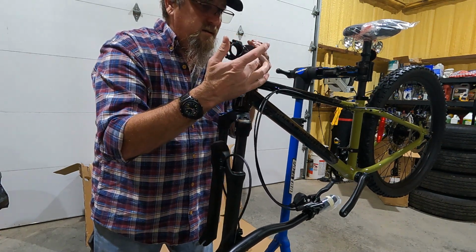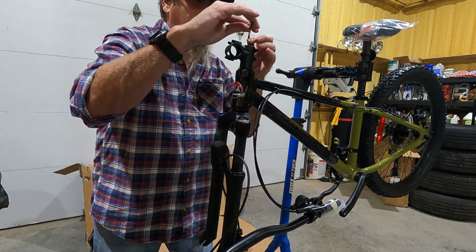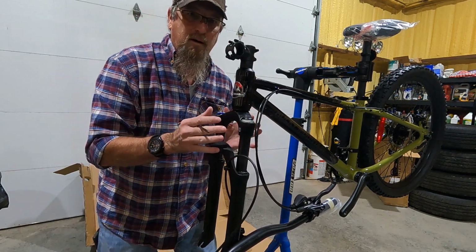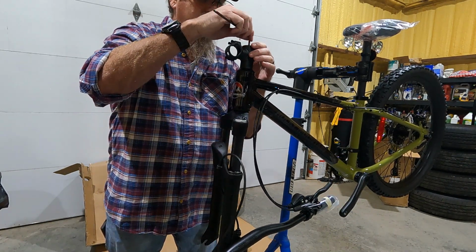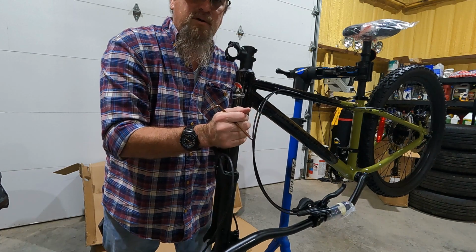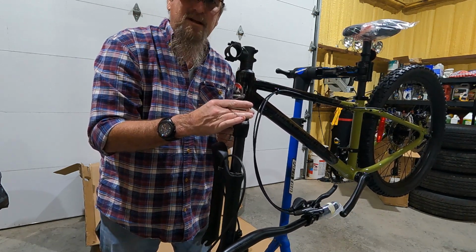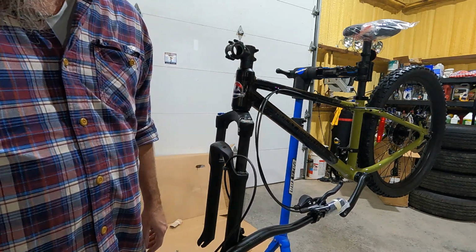So you're gonna loosen the clamp on the stem, the two stem clamps, and then you're gonna tighten the crown nut down just a little bit until that play goes away. That's the sweet spot. You don't want it so tight that it's grabbing. It doesn't steer right, it'll be sticky steering, it'll wear out your bearings, it's wrong. And if there's play, it's too loose. So you just ride it and hit the brake. As a rider, you should always be aware of the tension on your headset. These bearings seat, they wear in. So, just part of bike maintenance.